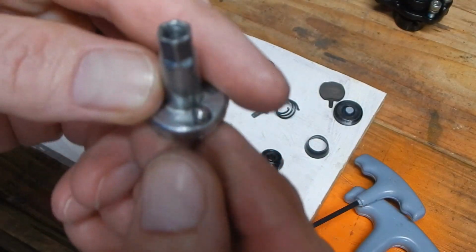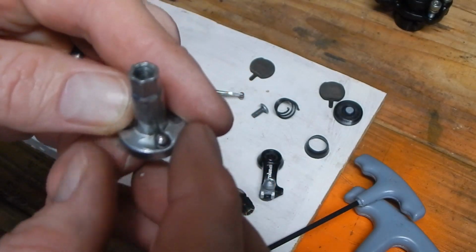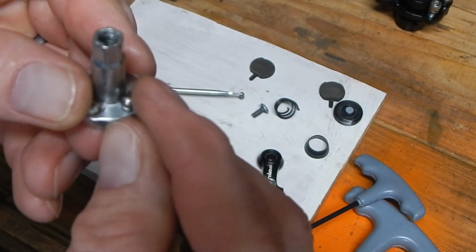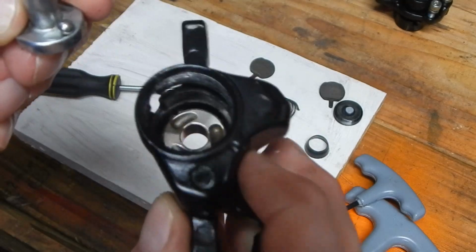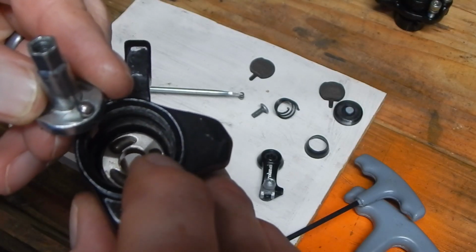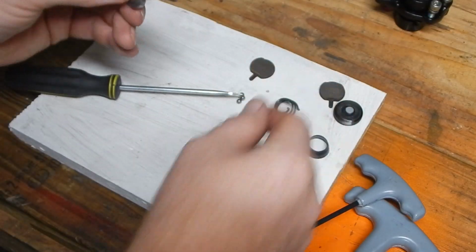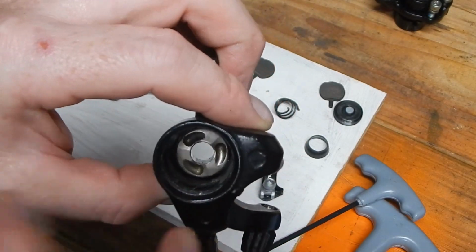When the ball bearing is sitting in its resting position, it's down as low as can be. And then as you turn, when you pull your brake lever and it rotates that leverage arm, it makes this turn. And then as this turns, the ball bearing goes up the ramp. Now, because there's a ramp on both sides, this seats at its deepest point. So think all the way forward, as I'm pointing there, all the way forward there, and all the way forward here. So this little leverage arm that's attached to this, as it rotates this pusher, it's working counter of these ramps.